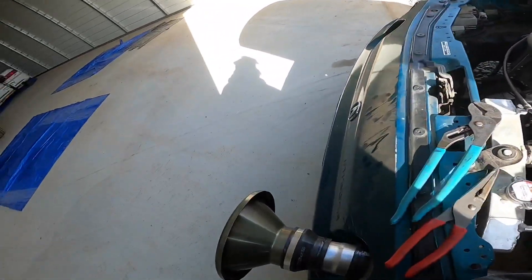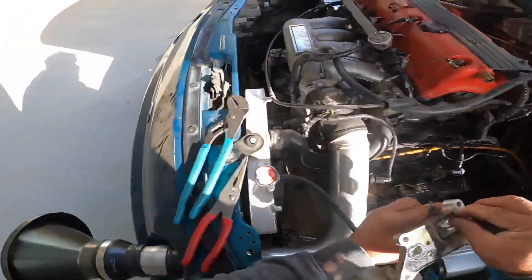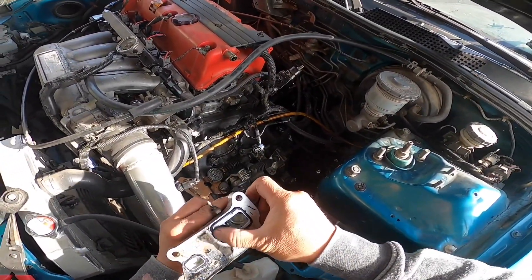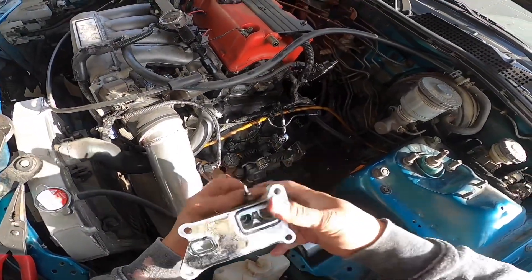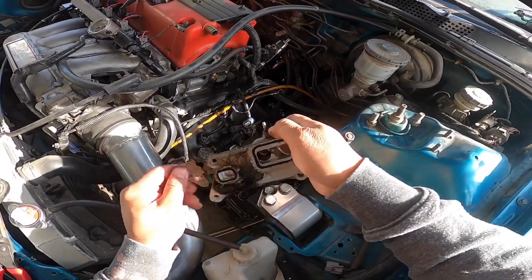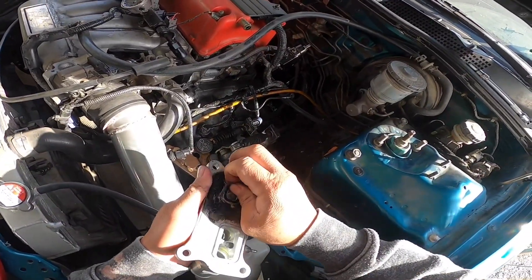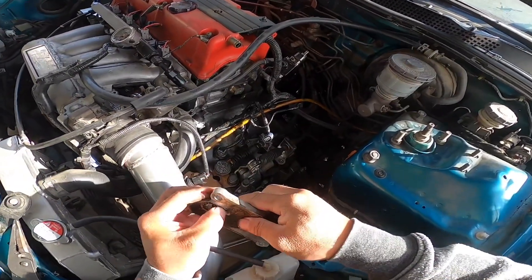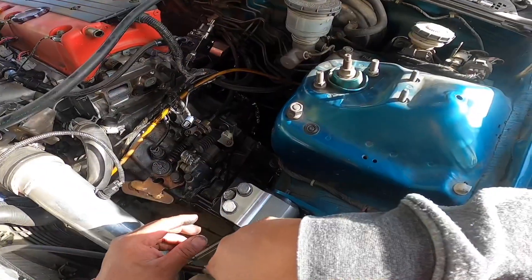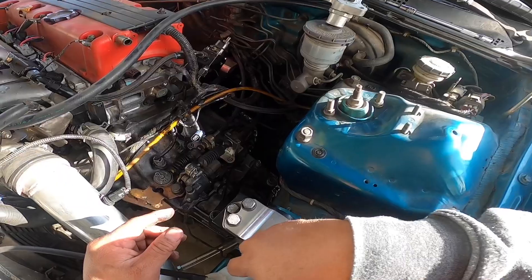I'm working on the new shop — all those blue tarps we put underneath cars because I'm trying not to get any oil on the floor. I also want to try to get it painted or epoxied. I think it's this one that was leaking, probably getting hot because that's the EGR. Honestly I like the K20 head better because it doesn't have this crap on it. Let's take the o-rings off — I'll probably just not use the gasket, I'll put a little bit of silicone on the groove and let it squish out. I didn't bring the gasket with me so let me put this on pause — I'll go walk back to the garage and get some Honda bond for it.